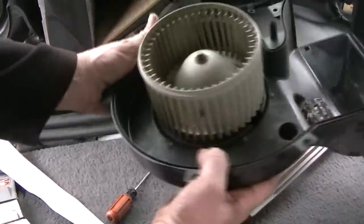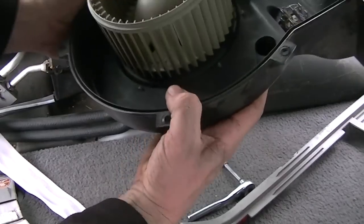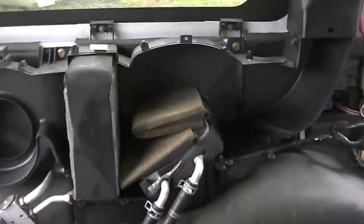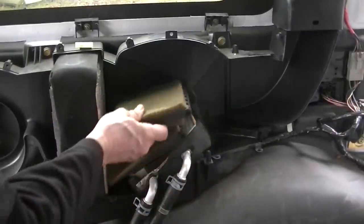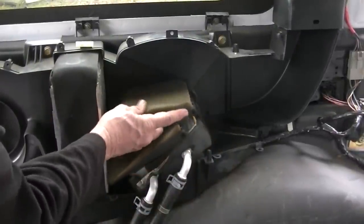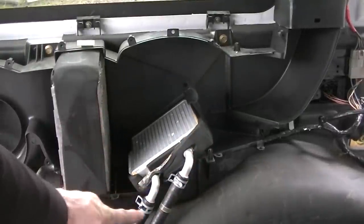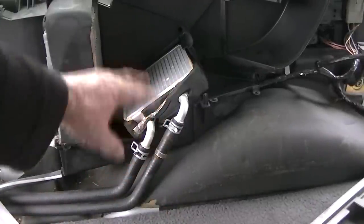So there's our panel — we'll get it off and everything. And there's the blower motor. Check it while you're in there, it's easy to replace. When you pull this cover off, just be aware that you will have your blend doors and stuff here — you'll have to work with those, but these are easy to put back in. So there's the heater core. All we have to do is disconnect these two clips on the bottom there and replace it with the new one.